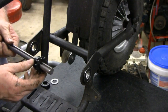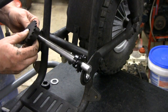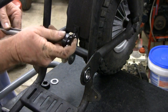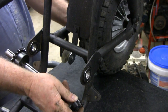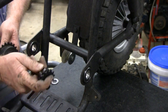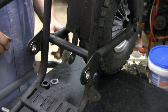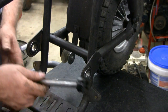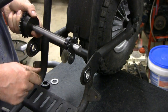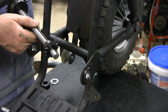All right, we got a 12-tooth sprocket going to a 21-tooth on this side, going back to a 60-tooth sprocket, and the tire was a 14-inch tire from top to bottom. That way, because you have to calculate that by pi and figure out how many feet per second it goes and everything. So, a lot of calculations there, but somebody calculate and tell me what you think. All right, 12-tooth from the clutch, first sprocket to a 21-tooth over here, and a 60-tooth on the rear wheel.